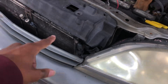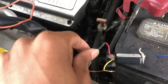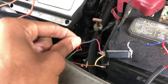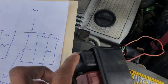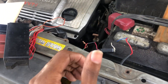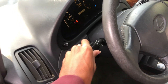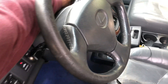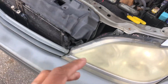Nevertheless, I'm using that module, and this wire powers each of the daytime running light halos on both sides. This is a good approach — I've used this for other modules before. These are made for tail lights but you can use them for other things because they cancel them out. This is a good way to have 24-hour daytime running lights, and these will lose power when the vehicle turns off.